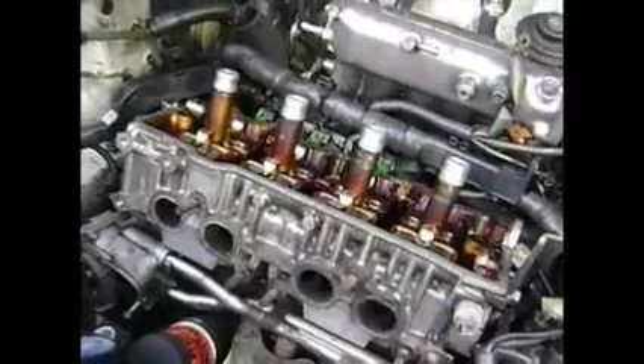I got them all torqued down — took some doing on that last 47 foot-pound pass, but if you've got a digital torque wrench it makes it a little easier. You could even put one of these adapters on a cheater bar for more leverage. After you've got those head bolts in, put the cams back on, put the timing belt on, and button everything else up and you'll be good to go. Thanks for watching — give it a thumbs up and subscribe if you liked it.